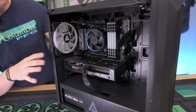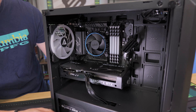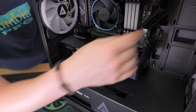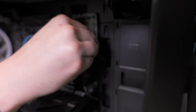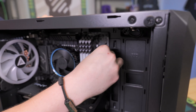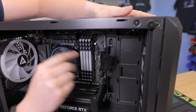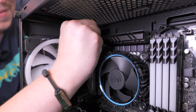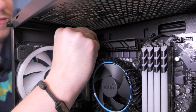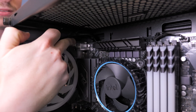So now we're going to pretend this power supply is bad and remove it. First things first: you have your 24-pin — go ahead and pull that out, that's your main power. Next up is your CPU 8-pin, usually the hardest one to get to because it's all the way up at the top. If you have a radiator, that radiator usually has to come out. That's a 4-plus-4 pin — that's our CPU power.